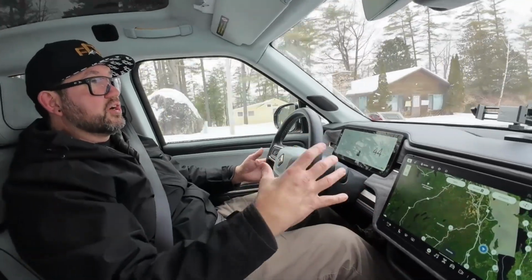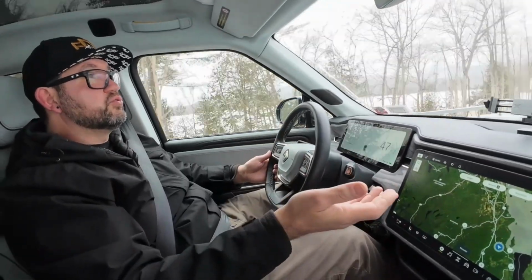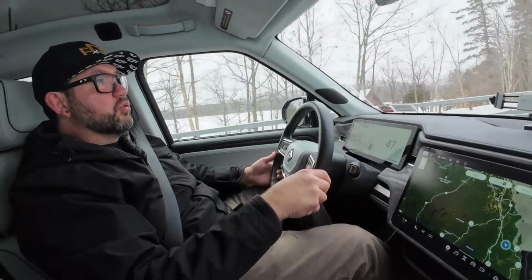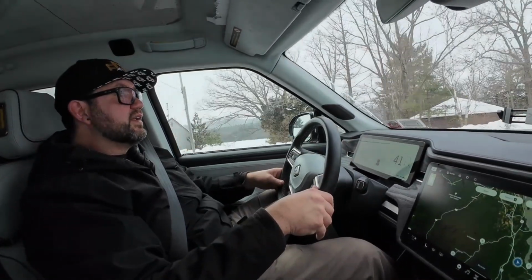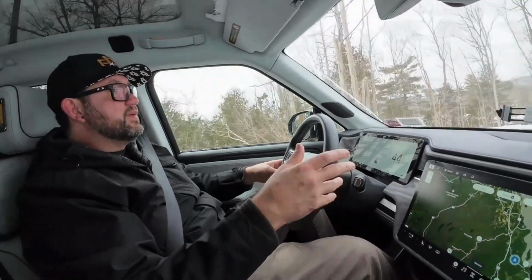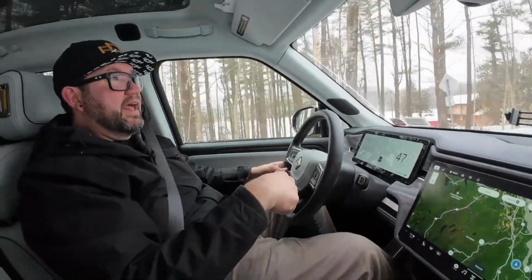The Rivian has a charger that came with two different plugs. You plug it in for 110, or you plug the next plug into the side of it for a level 2 220 charge. So my Rivian's mobile charger, that's 220 capable, puts out somewhere around 7-8 kilowatts to the truck. And if I had to guess, I would say, I can't remember, I used to know this data, maybe 10, 11, 12 miles per hour of charging added back to the vehicle.